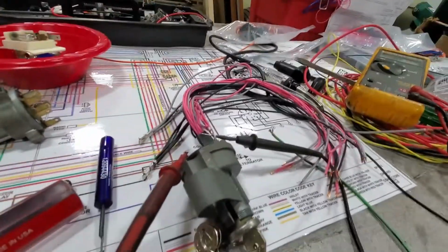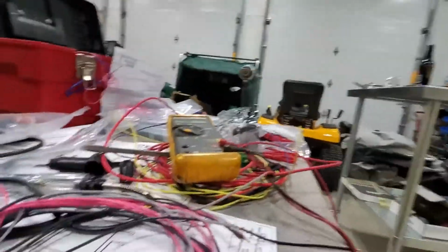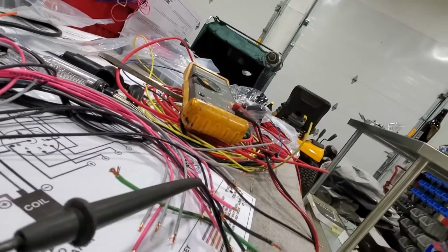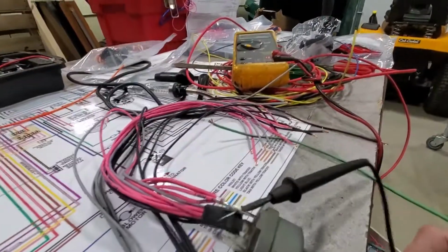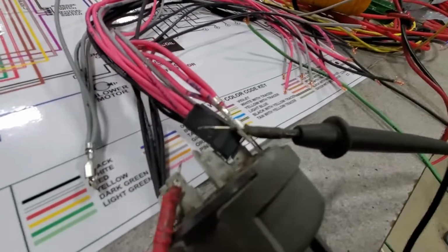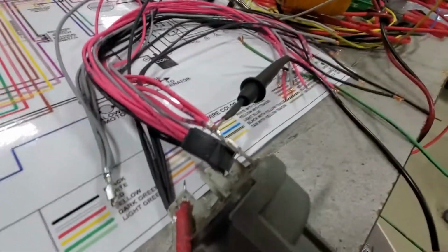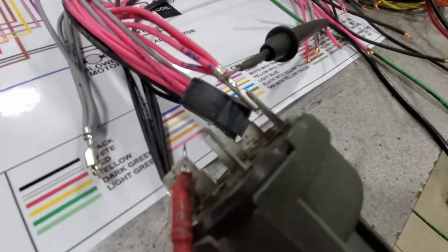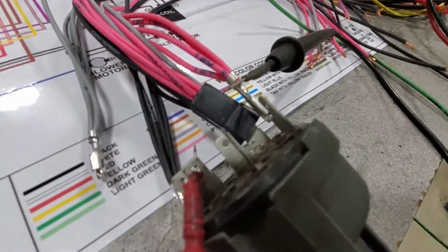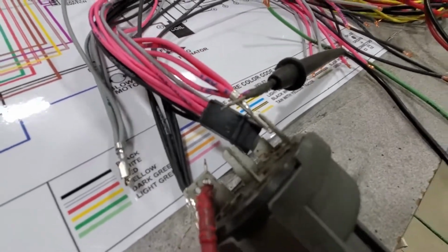I wonder how I'm going to do this and hold the camera. So, let's see what we can do here. If I turn the key to on, eventually. Okay, right now I'm looking at the starter solenoid position. So I've got to crank her over. So we've got starter solenoid. Right now I should have, okay, so we're in run and in crank. There should be enough of a capacitor in the MSD to deal with that.